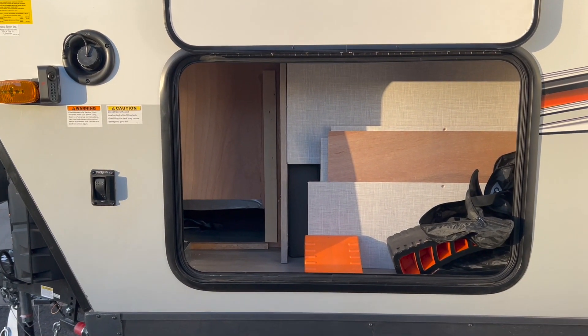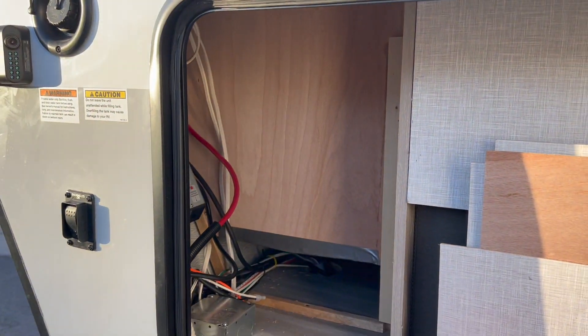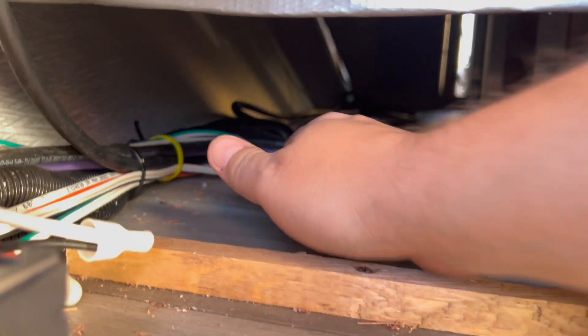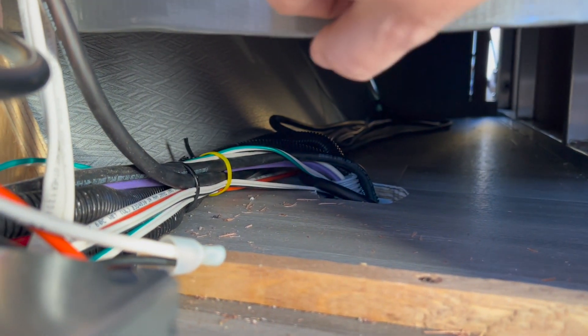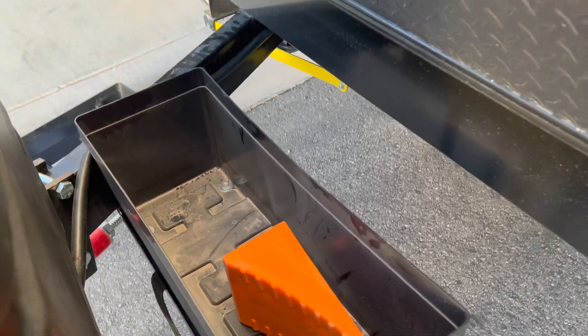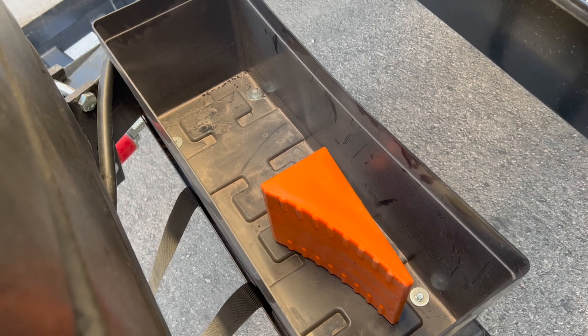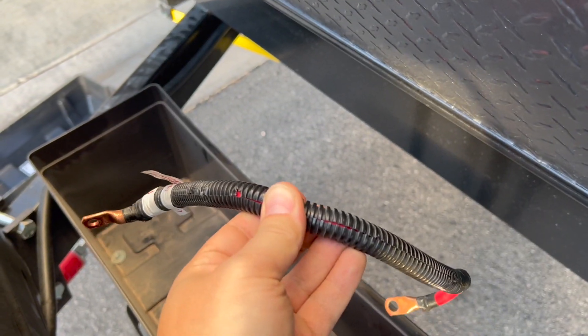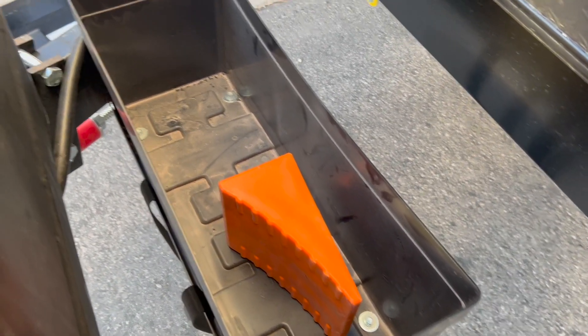So let's talk about rewiring. This is the other side of the pass-through — I got rid of two panels so I could have access to the trailer. I had to cut a section out because it was all wood with just a tiny access hole, not enough to get in and do what I needed to do. I put some duct tape so I didn't cut myself on the poor cut job. The first thing I did is remove every single wire from the battery — all three — so there are no hot wires. I got rid of the small ground wire and took the thick negative wire and connected it to the frame where the old ground was.